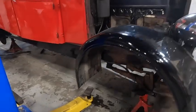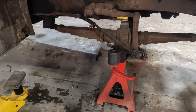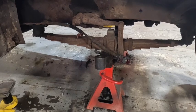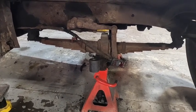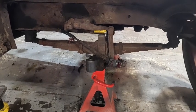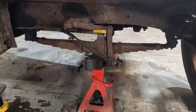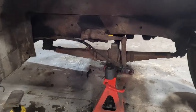And of course, we're doing the brakes and the front end here. We had to do the kingpins. There was a ton of slop on these kingpins. I mean, you jack the thing up, you could see the wheel flop down. It's never had kingpins in its life. So we're going through and doing everything and making sure it's right, and greasing the chassis, checking everything on these brakes. The brake shoes are out being rebuilt right now.